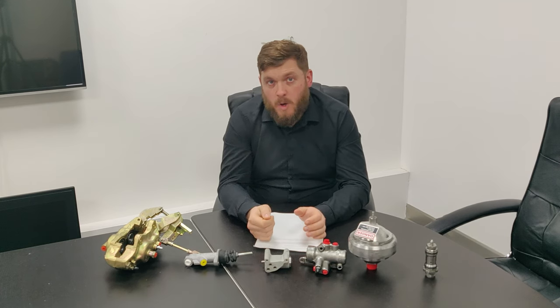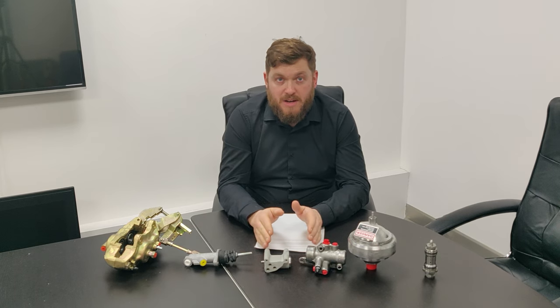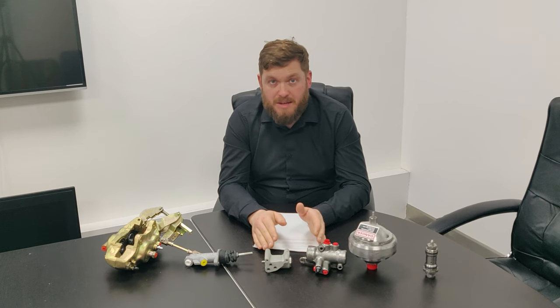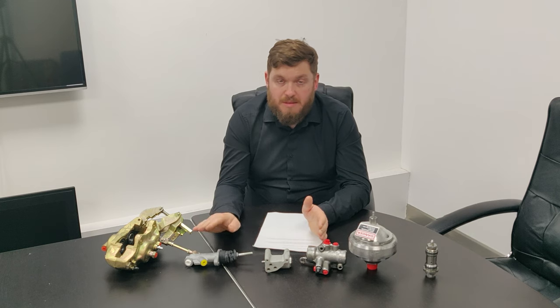If you leave the ignition on without the engine running, you keep pumping the pedal. Before long, the red lights are going to come on to show that you've got below a low pressure. Keep going, because it still could have some pressure in the system. 70 to 100 pumps, you should be down to nothing. Then you can bleed the master cylinder.